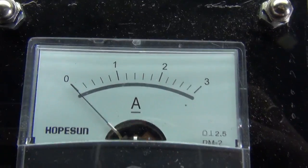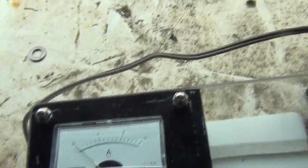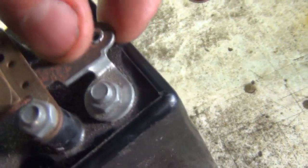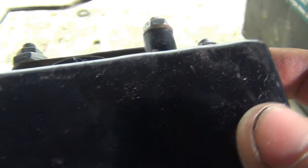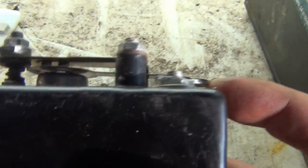And at the same time, you don't want it producing not enough current, otherwise the engine won't even fire properly. So the way we adjust the coil box — this particular one is putting out too much current — this little tab on the top here, the way you actually adjust it is you actually bend this piece. You bend it up or down depending on whether you want more or less current. This one needs to be bent — you can see it's been bent upwards to give more current. Let's find a pair of pliers and give that a go.